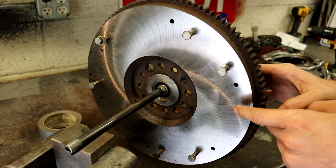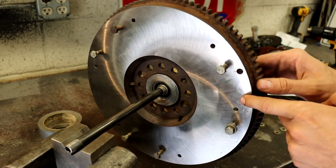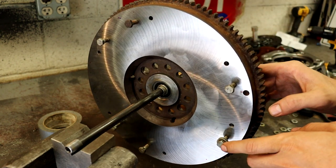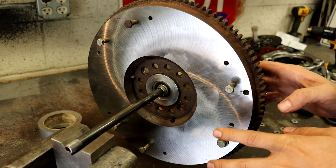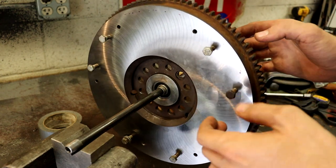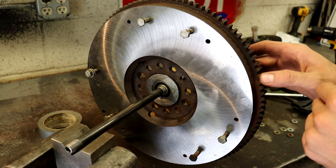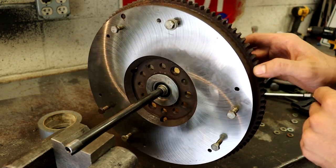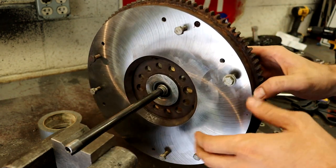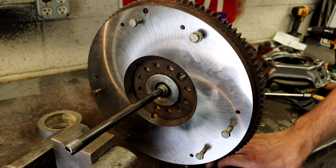Of course anything I do here is not as good as professional dynamic balancing, which is what I would do if this was the final assembly of everything. But I'm just trying to get the car to move — and boy, this is super, basically perfect. I move it into position and it doesn't move at all no matter where I set it, so that's looking fantastic. I'll put the pressure plate back on and fiddle around with this a while more to get as close as I can, but you get the gist of it — it's going to be good enough for what I need it to do.